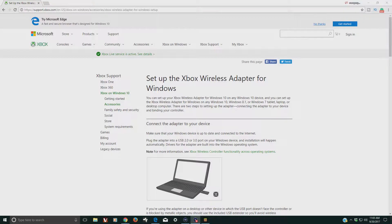I took the Xbox One wireless adapter for Windows and plugged it into my Windows machine into a USB port, and it automatically detected it and loaded the driver. Then all I had to do was press the button on the side of the wireless adapter — a little LED comes on to indicate that it's on. Then I turned on my Xbox controller and pressed the button on top to sync it to the wireless adapter, which is the same procedure you would use to link an Xbox controller to your regular Xbox.